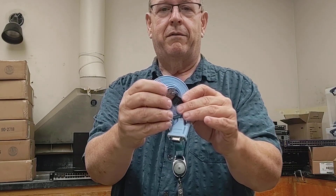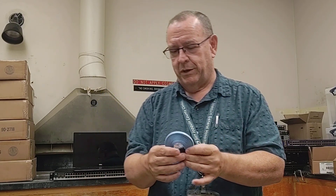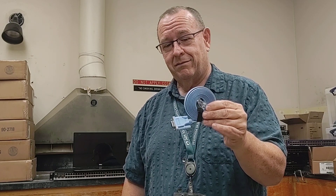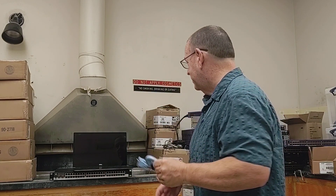There are all kinds of other serial cables. Cisco guys, here you go — same thing: RJ45 on one side, DB9 on the other. This will not work in an Extreme switch. However, it will work in my Palo Alto firewalls. I don't have any Cisco switches, so the Palo Alto firewalls are the only thing I use it for when I have to console into them — which I usually don't.